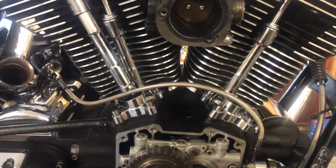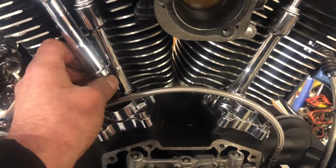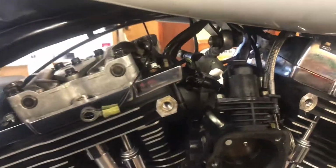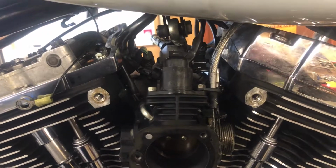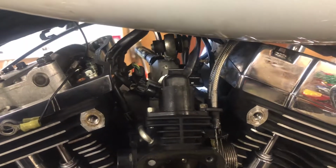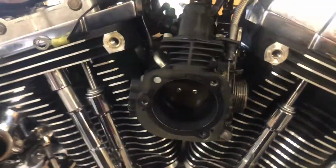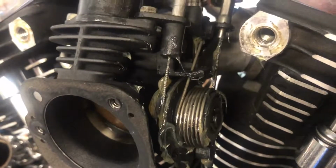Right, that's at half an hour. Spinning free now, so I'll turn the motor over, get the other one done, get the front exhaust done. But while I've been at it here, fitted up the throttle body, got the inlet manifold correctly fitted in, and everything's wired up, so that's all ready to go. Greased up the cables just to make everything nice and slippy for the next while.